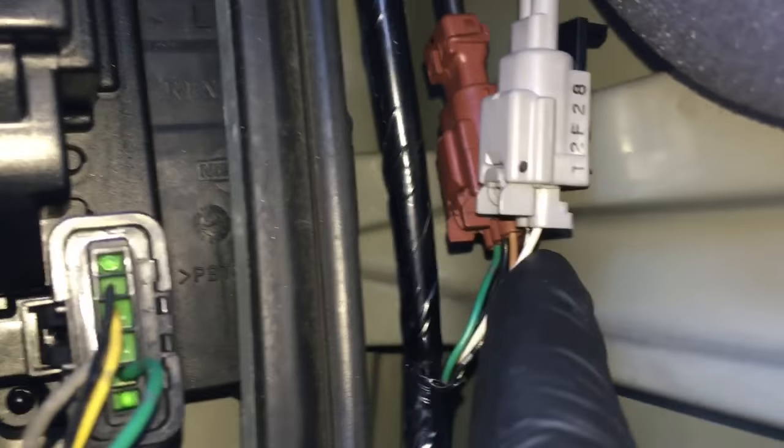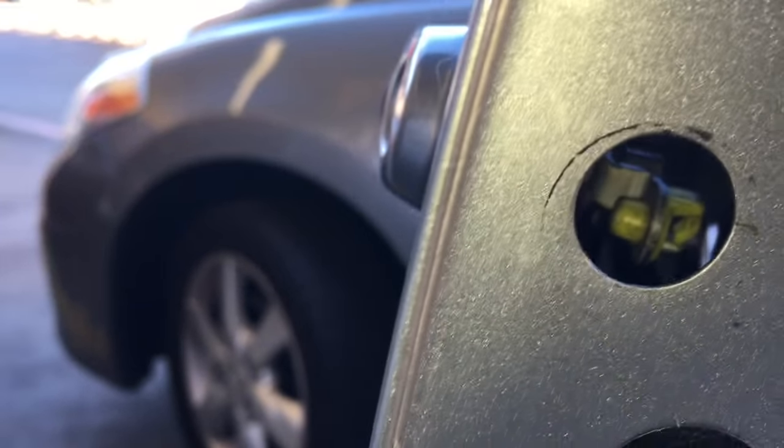Make sure your wires are routed through here, and I recommend you zip tie them so they don't get caught on the window track. Plug them in and make sure they're mounted. Then reach back there and reinstall the lock rod into the door lock actuator. One tip: look through the hole to see the rod, plug it into place, then flip the little yellow clip down to lock it in place on the lock cylinder.